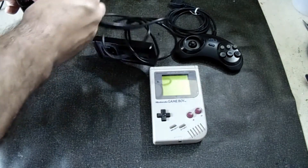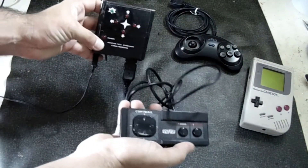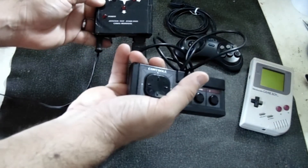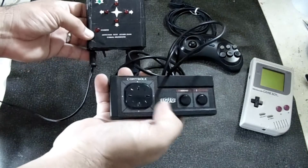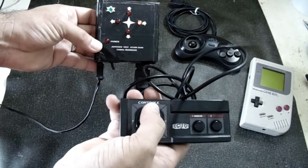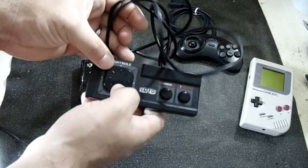Let's start here first with the Master System. This control has a little defect — it's kind of rigid with the cable, but we can test it. The fire button works. The second button won't work because it doesn't have a physical connection for it. The bottom direction works, the side works, the other side works. The diagonal also works. But the top is dead and the bottom is dead — we'll see when we open it.